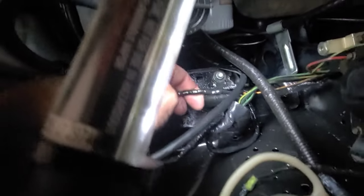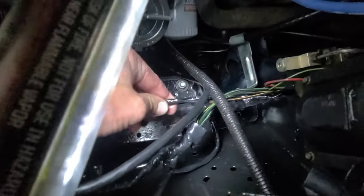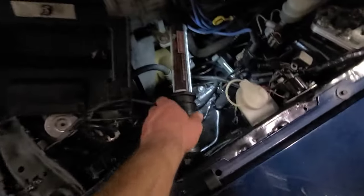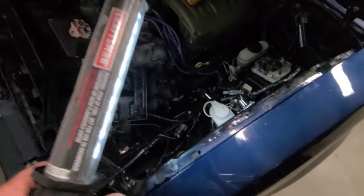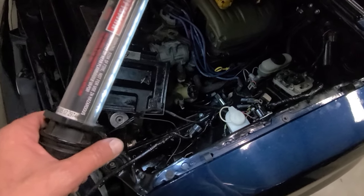The problem that I ran into here is that the connector is gone, and somebody has put in, I bet, going to be a butt connector or something underneath of this. And it looks like the ground here is attached to the harness. That's the only thing keeping the harness in the car. Everything else is ready to go. So I'm going to cut that, and I figure I'll upgrade it anyway, because whatever work was done underneath there, I didn't do. So I'll get a good opportunity to look at it and make sure it's connected properly. So that's what I got.